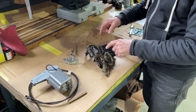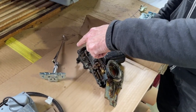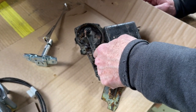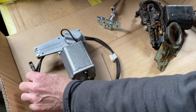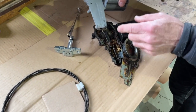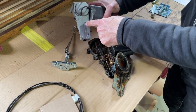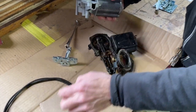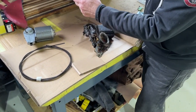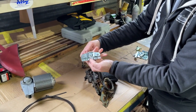What's actually more common in these, so now you have this wiper motor set up. This thing's basically just going around in a circle, and it's moving this piston, and this piston has a hook on it that engages this cable. That's what we're looking at, is exactly this, but cut away. So the piston's under here, moving in and out through this hole, which is what the cable runs in. The cable actuates these little gearboxes. That's what we're seeing. It just goes